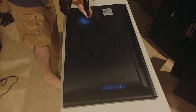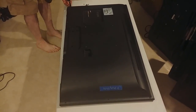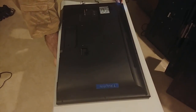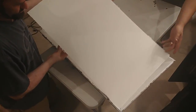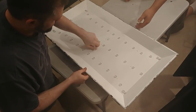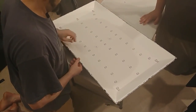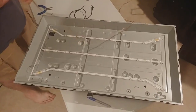Here we have a 40-inch Samsung UN series with an image on the screen but no backlight. We have a makeshift LED tester — a buck boost board bringing our 12-volt AC adapter up to about 35 volts.